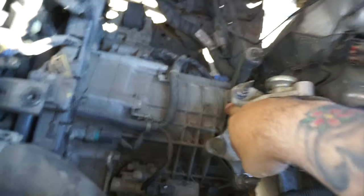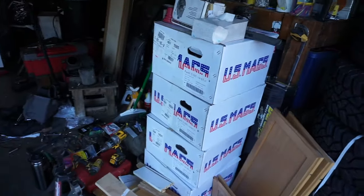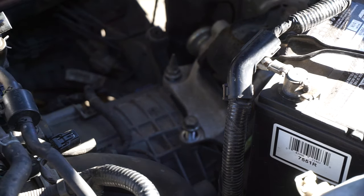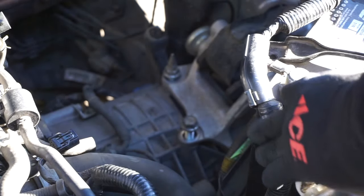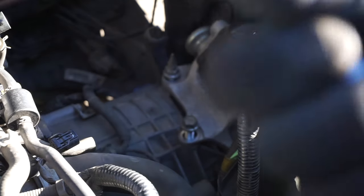So I am taking the motor mount right here and I'm gonna add the spacer on here, then I have to go on the other side and put the spacers on there, and then come down here and take four bolts — two in the front, two in the back side of the motor — and add the spacer on there. I'm gonna show you. I already have the wheels and I got the tires. I went ahead and took out the air filter. There are three bolts in here. Aerogenics actually supplies you with the deep socket to take these out.